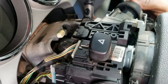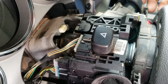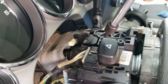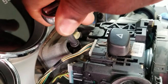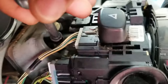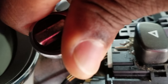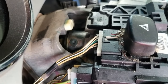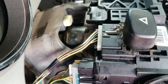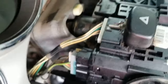I'm going to crank it up and turn it around the other way so I can see my other screw. I'm just going to snug that one up as well. I gave that one maybe a quarter turn — it barely moved, but there's no more play like there was earlier. This is really taking a whole lot of play out, guys. I'm amazed. Matter of fact, I'm going to get some Loctite and drop it on those screws also. Let's go ahead and lift this portion up and see if we can see some play in our intermediate shaft down here.